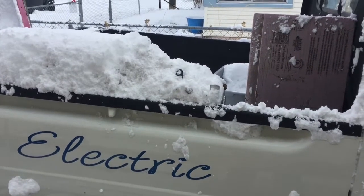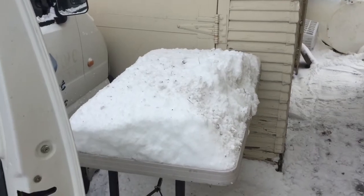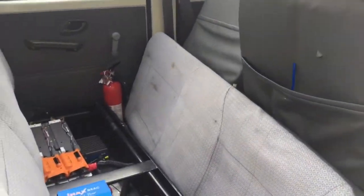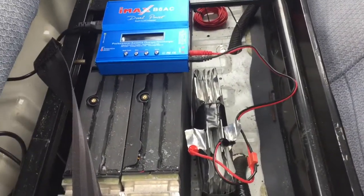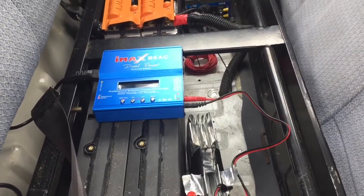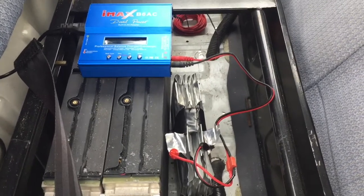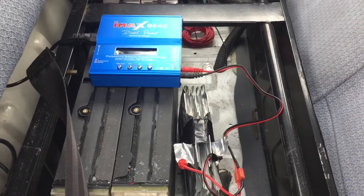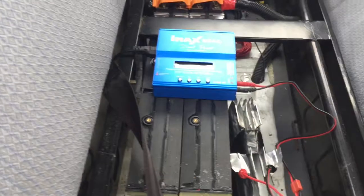Here's the electric mini truck that we've been working on. It snowed about six inches here last night. Something I was doing with those lithium titanium batteries that we talked about — I just put them together positive and negative, negative to positive, till I got my 12 volts. It charged up to about 14 and a half volts last night, which is pretty good.